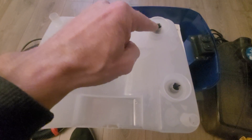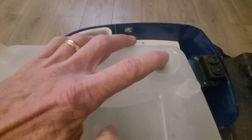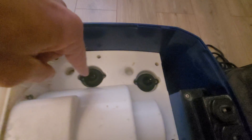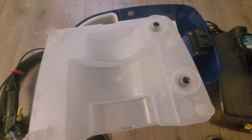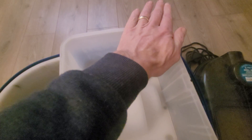What I found was these little valves here — there's a spring underneath and they only move a little bit. When you put the container in, it pushes into these valves and they're supposed to open a little bit, which allows the water flow. For some reason it just wasn't getting the water through.